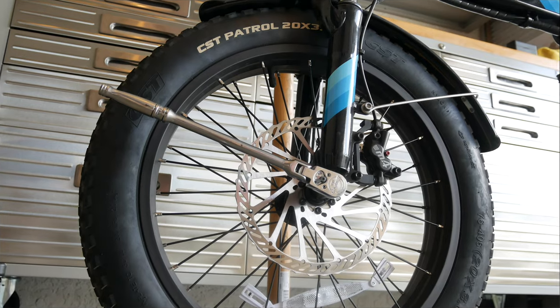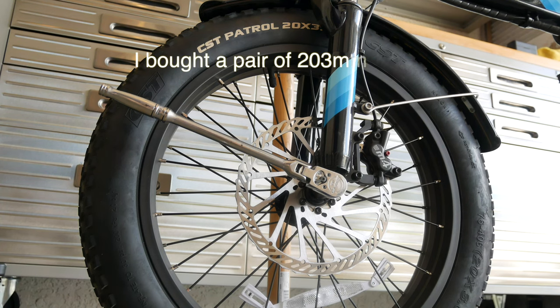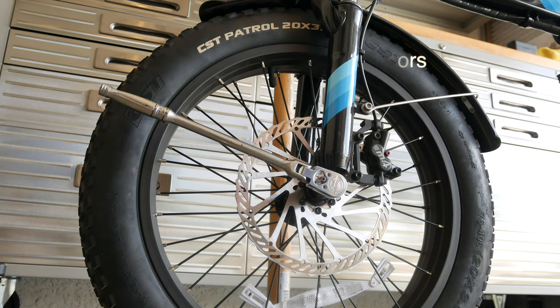So if you've been following my channel, you know that I'm changing my brakes over to four piston hydraulic. Four piston in the front, four piston in the back. Now I haven't decided on the rear rotor size. I happen to have a 203, which is an 8-inch rotor, and I'm probably going to put that on here. On the front of this Lectric XP 2.0, I have an 8-inch 203mm front rotor.